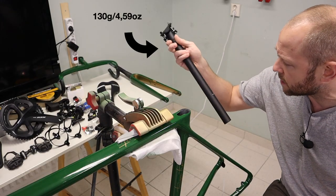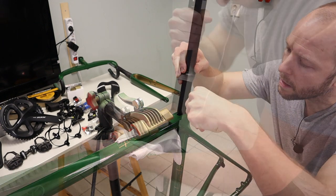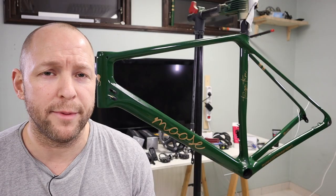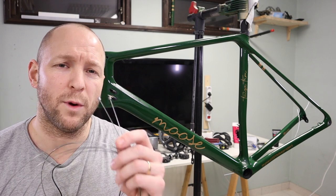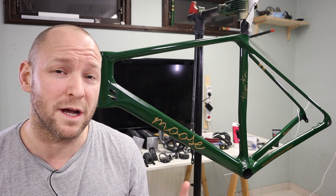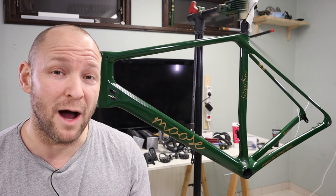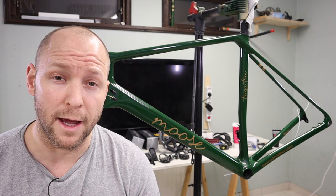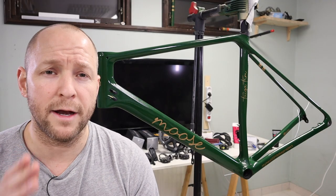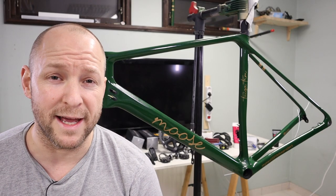I have this really nice Chinese carbon post - it's very very light. To route the cables it's very important to see where they start. The wires have this little knob on them, and if you start routing them down the frame directly you'll have to do it all over again. So in order to route the cables, I first have to thread them through the lever, and since I have internal cable routing on my handlebar, I have to thread them through there too, which means I have to mount the fork.